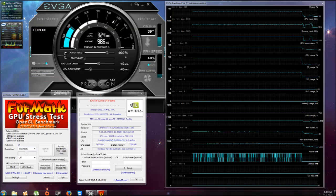Here are our pre-change results for Furmark, which is a GPU stress test. Basically the card maxed out at 73 degrees, but that is only due to it being throttled after 70. On the GTX 600 series cards, after you reach 70 degrees Celsius they throttle themselves — meaning lower power, lower GPU usage — and attempt to balance out the temperatures. You can see that represented on the right-hand side with the squiggly lines on the graph; that is the card being throttled. This is the stock paste running 100% for 15 minutes, and very quickly it reached a point of throttle. Let's see what changing the paste will do for our results.